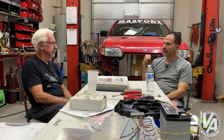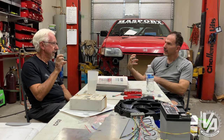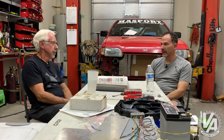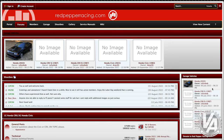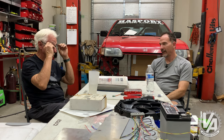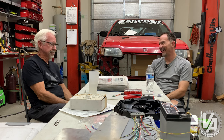Those knuckles are getting harder to find. Some guys have come up with another solution using the second-gen CRX hub and machining it down to fit into the OEM knuckle. There's discussion about this on Red Pepper Racing. Red Pepper Racing is a great resource if you're interested in doing the B-swap or K-swap — they have a Facebook page and a website where you can search back to information from the nineties, and the host has kept all of it.